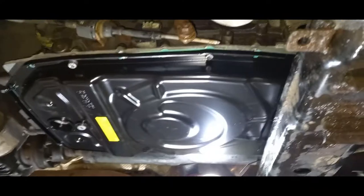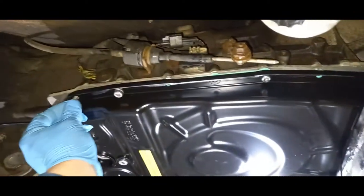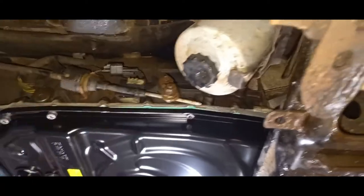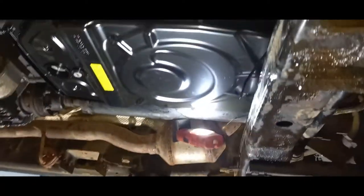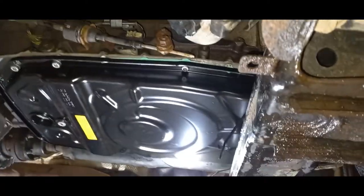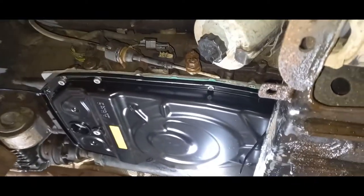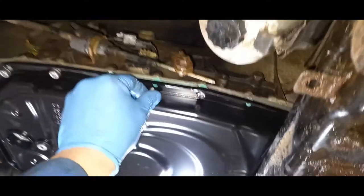We've got all these bolts in, as many as we can, then we'll cut those cable ties. We'll be very careful just not to nick the gasket on the way out. So just be careful running these bolts in. We'll run them all in. I'll do what I always do, start in the middle, work my way out, just like you're doing a head gasket. And then just do the final torque on them.